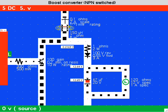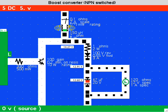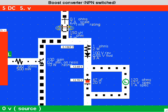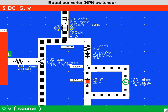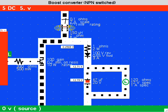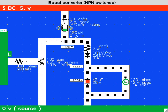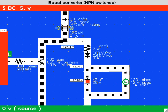The transistor turns on and current begins to flow, slowly at first, then ramping up. The transistor shuts off and the flux field starts collapsing. Attempting to maintain current flow, the coil produces however great an electromotive force is necessary to overcome the volt level on the capacitor. The result is a stepped-up charge on the capacitor.